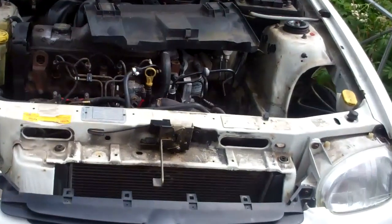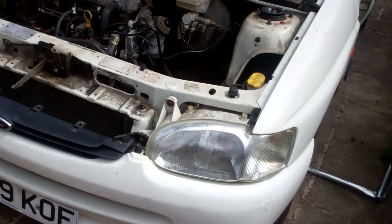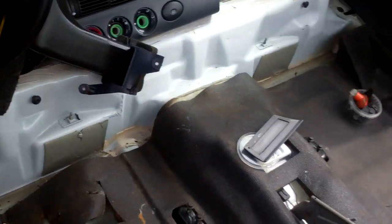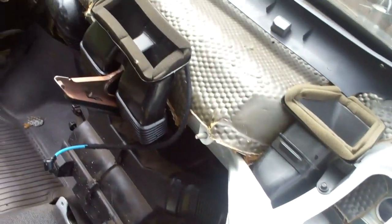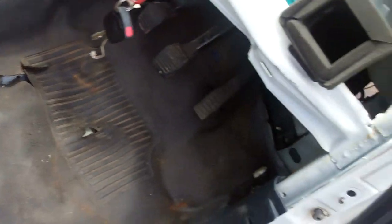So what have I got? This is one which worked — it was petrol — but the diesel engine is out of that van and has now gone back in here. The wiring harness has been removed out of here, what a pain in the arse that was. I'm taking the carpet out of this and putting it in the van, because the van just had a knackered old rubber mat. Every bit of wiring has had to come out of this to go into the van, because the diesel wiring harness and petrol harness just are not compatible.